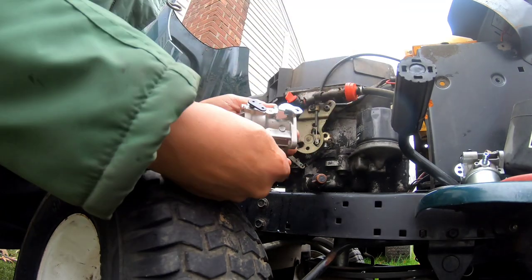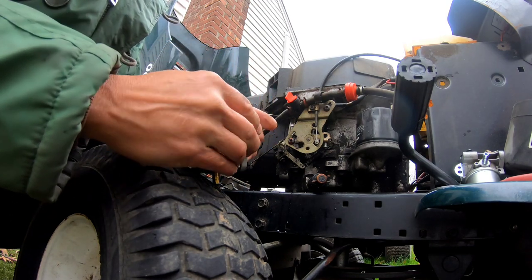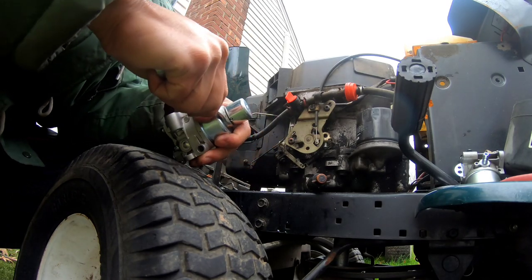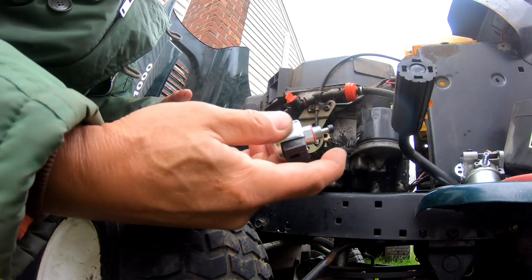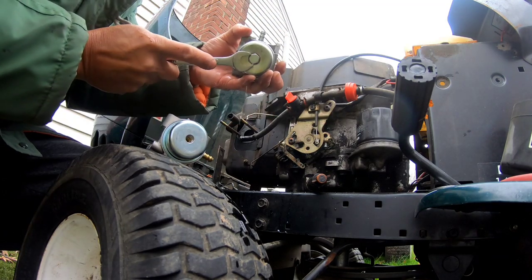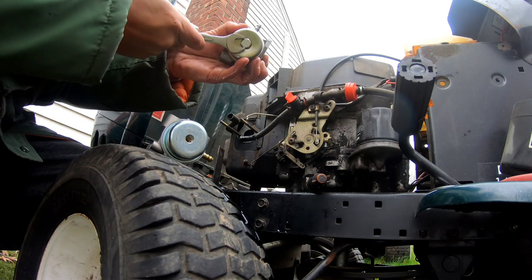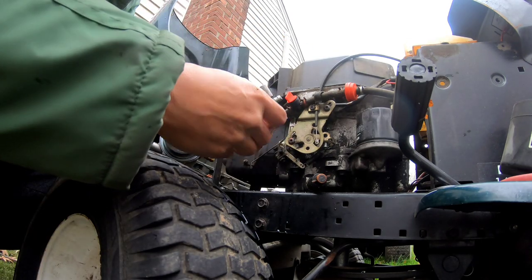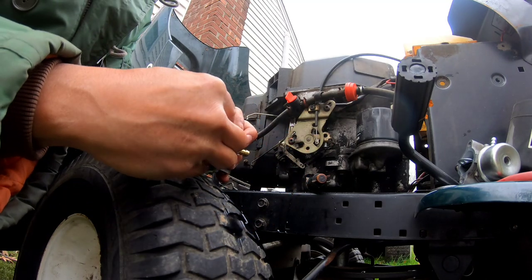Get the new carburetor that doesn't have the grommet. It's the plastic grommet in the hole. Okay. I'm gonna remove the fuel solenoid. Remove the bowl nut. Crap. Grass is gonna die around here for sure. Of course, this doesn't. Yeah, it does. Okay. Replace the nut only.